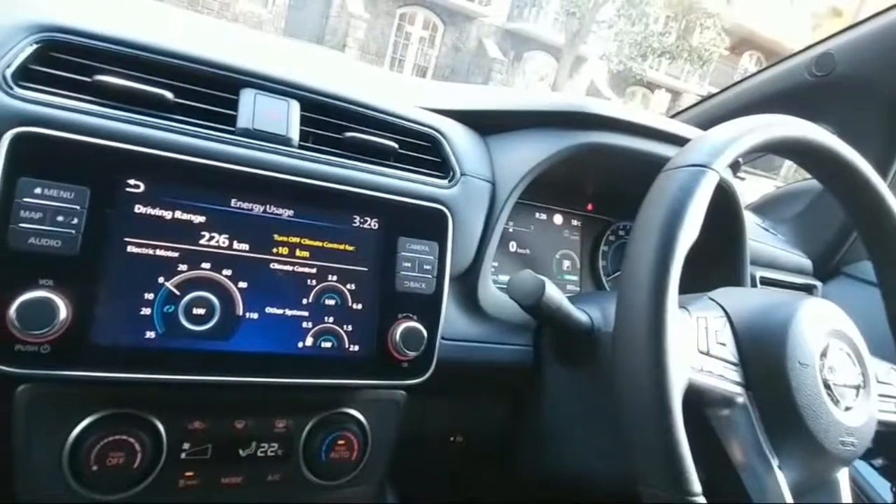It's only a 270-kilometer WLTP range. I don't know what the onboard charger is on here - I think the onboard charger is only 2.7 kilowatt, I'm not very certain of that but I will find out for the next video. So I'm going to suggest maybe 10 kilometers per hour maximum charging rate. If you do more than 100 kilometers a day, you need to put this thing on charge for at least 10 hours - that's my guess right now.